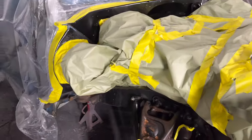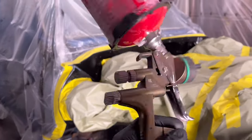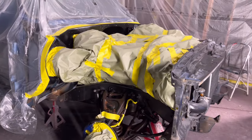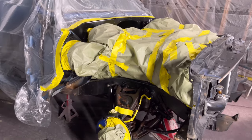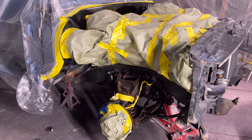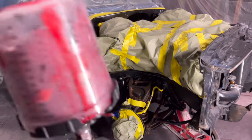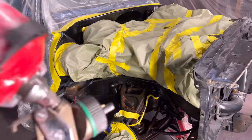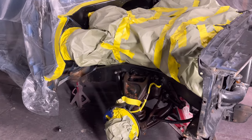I'm not about to, store's closed, it's late. So we're just gonna make it work and we're gonna pile that red up until we have a bright red. So let's get it. We're doing a firewall and then we're doing the brakes first and then we'll let that dry and then we'll dial our gun down and fluid and fan down damn near little to nothing, will airbrush the black on.